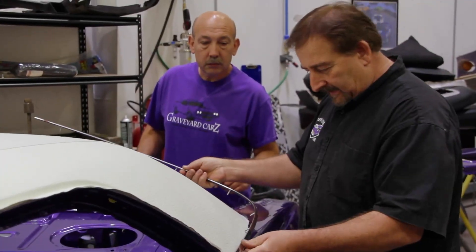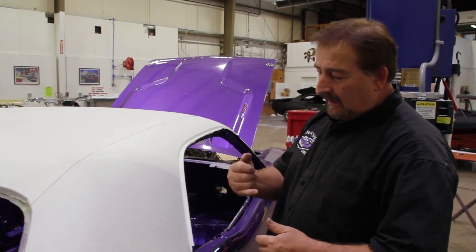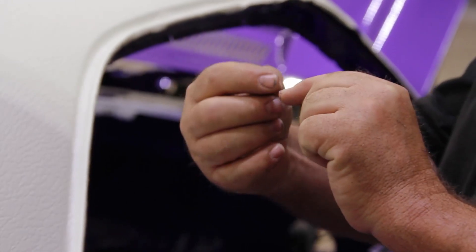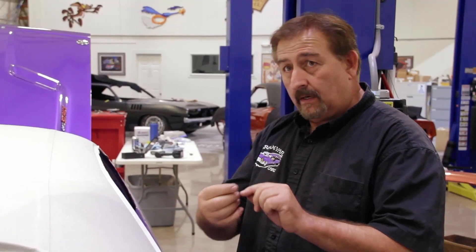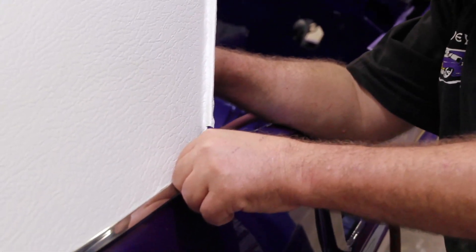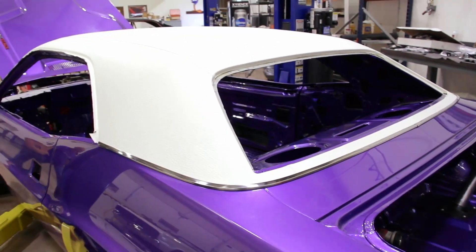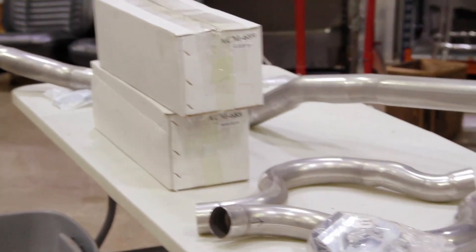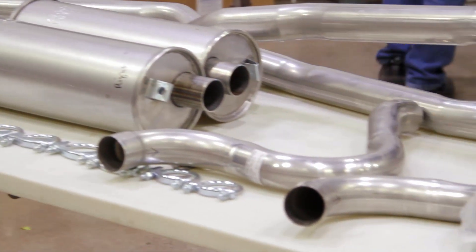We're hoping to get the bumper on, exhaust system on, wiring under the hood, vinyl top moldings, and about a half a dozen small things underneath the car buttoned up. That car is moving along really fast. Here's the thing putting vinyl top moldings on — body men don't always take the time to look out for the guy that's got to assemble the car later. Inside there, where the clip goes, there's a stud on the clip and it has to have a nut put onto it — that's what retains it in place. There's welding slag where the quarter meets the roof on this one, and that welding slag is in the way of him being able to start the actual nut on there. The vinyl top moldings are on. We got all the exhaust system out for the Challenger — this is unique to the 440 six-pack. The 440 four-barrel used a different system, and the Hemi used a different system, as did the LA engines and the 383s. But this is unique and correct for our six-pack Challenger.